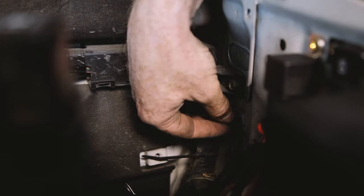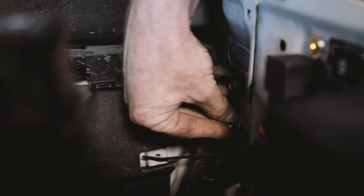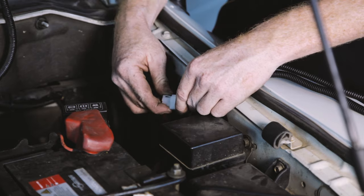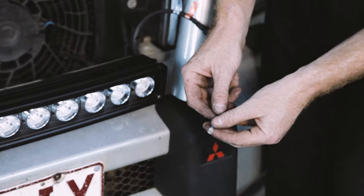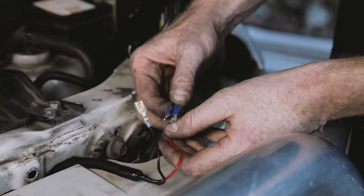The final piece in the installation is the wiring section to your light bar itself. The earth will need to be attached to the negative terminal of the battery or a bolt with bare metal contact to the body, and the positive will just plug into the available connection. Then run the wiring down and connect them to the LED light bar. Crimp and heat shrink as necessary and ensure the connection is watertight.